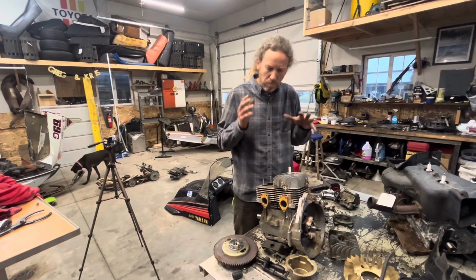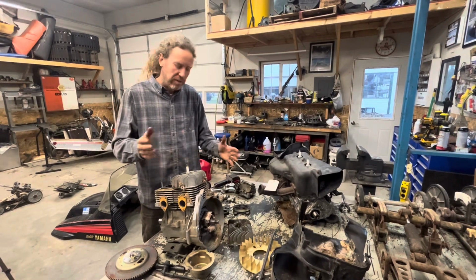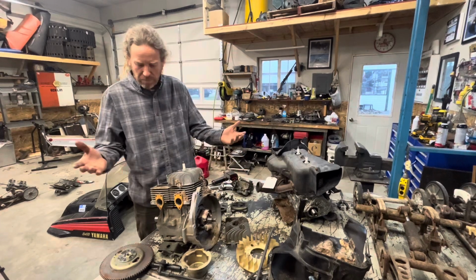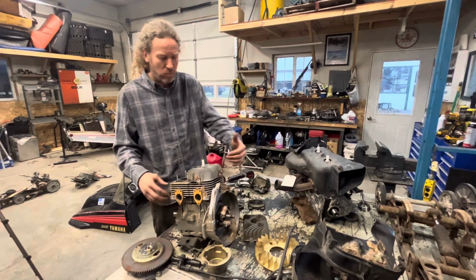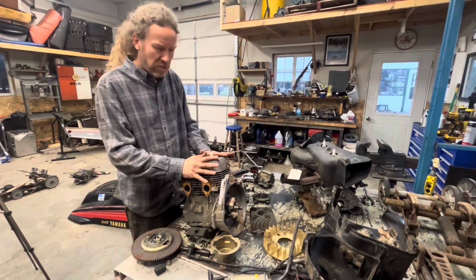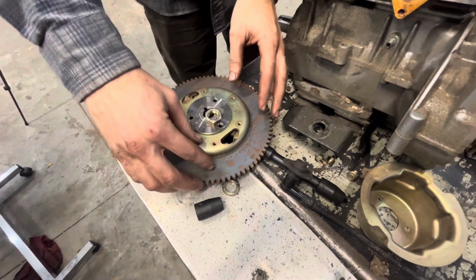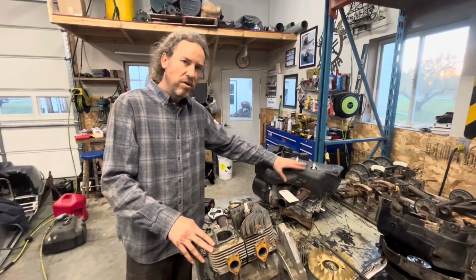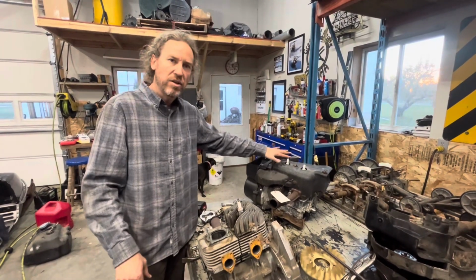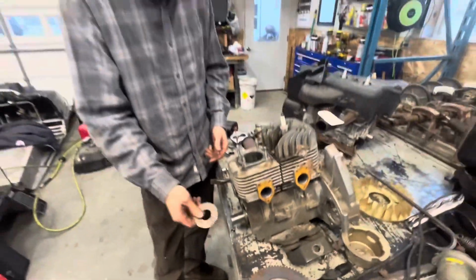So that kind of leads me into more on the engine build here. When we build these for the racing, we're not professional racers or anything like that, but anytime you're building anything to go fast or make more power, you want to lose as much weight as you possibly can, and any weight you can reduce out of the rotating assembly is huge as well. So the Ovation here had electric start on it, so that's going to go. The starter is kind of a heavy piece for what it is, and then the magneto here has this built-in big old flywheel on it. That's going to go. I'm going to see if I can use the magneto off of this engine, which won't have that because this was not an electric start engine. And then the oil pump driver was on the crankshaft here. It's not much, but it is rotating weight, so we're going to get rid of that.